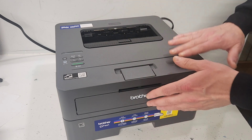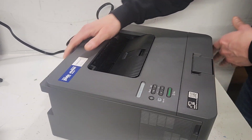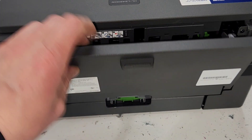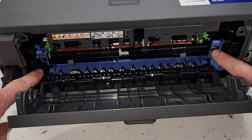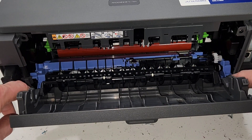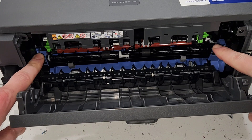There's going to be either the front door or the cartridge cover, and there's also a cover on the back of the printer. When it's talking about the fuser cover, it's not always the outside cover — it usually refers to the inner cover. You can see the fuser mark on the left and right, and if that one is open slightly or fully, you will get the message that the fuser or the back cover is open.